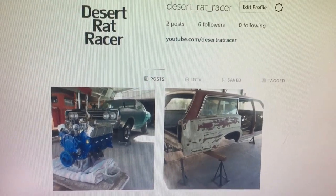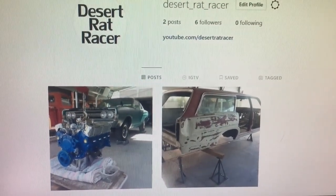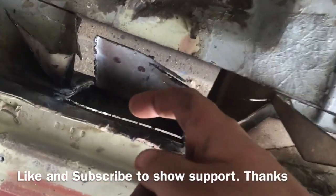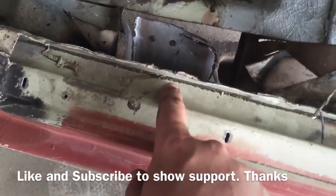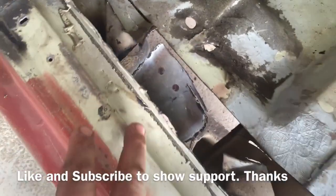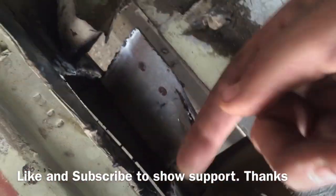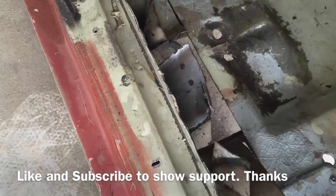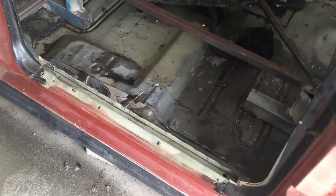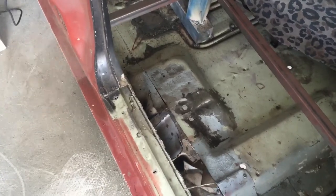I'm starting to cut into the floor — you can see the rocker panels are just dumping dirt like crazy. I might cut up as tall as this but I really don't want to go taller than this bottom lip right here because then I have to start getting into the pillar kind of weird. I'm going to do my first cut sideways right under that lip, and that should be tall enough. I already got the whole bottom of the rocker panel cut — it's really not pretty, the sawzall is kind of hard to control.